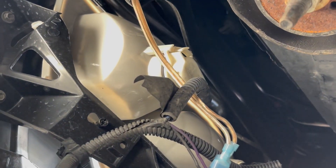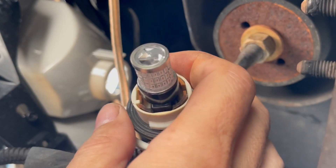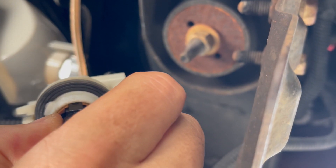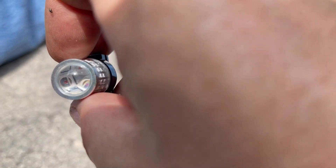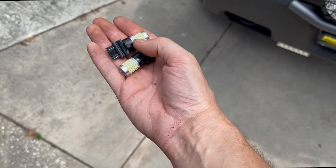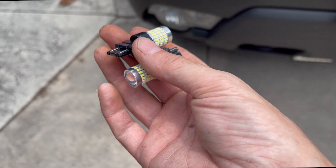So let's go in — they are LEDs. I'm going to show you, it's pretty easy to change them out. You just push this tab, turn this, and it comes up. Those are modern LEDs. There's no indication that they are red but they most definitely light up red. I can see inside that the filament is red. I found a couple of replacements and they don't look like they'll light up red. These are either taillight or brake light bulbs — you can use either or in this situation. Let me commence to popping these in and we'll see what it does.